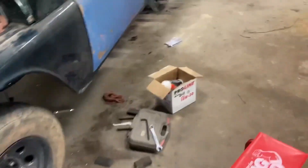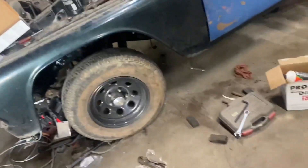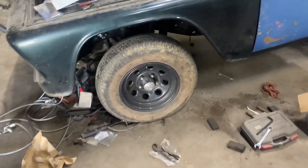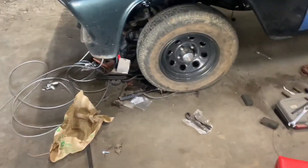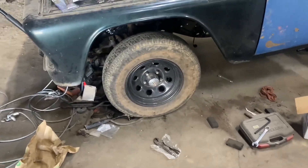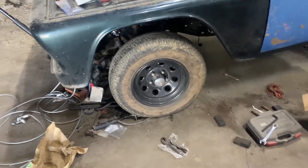That's how you put brakes on the front of these things. Most all of the Chevrolets from about 1970 through maybe even the early 90s all the way back to the 70s are basically the same thing. They all take that 3/8s Allen wrench to take them on and off. Take them off, push them back, and put the new ones on.